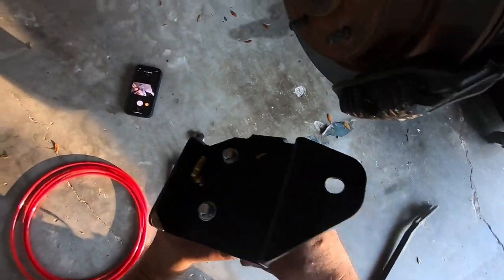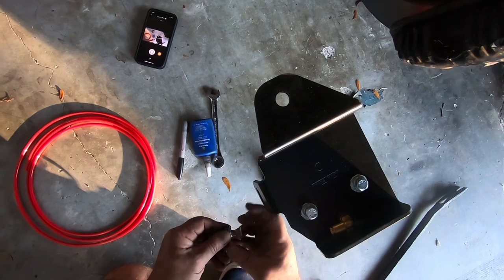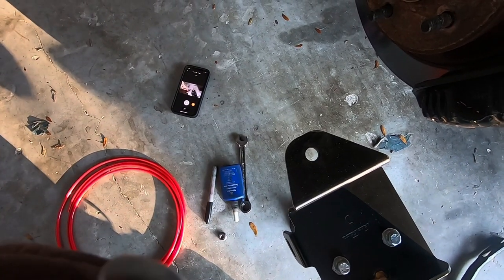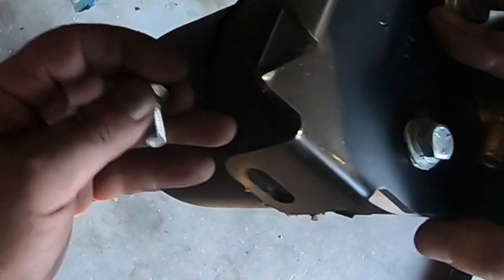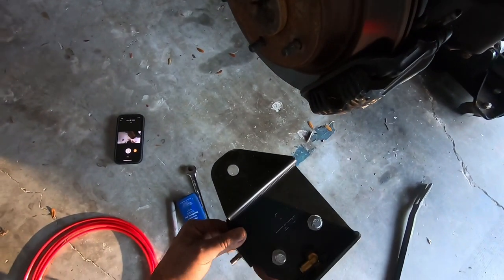All right, guys, got the air spring over here. And again, already prepped it. It's all ready to go. And it's going to go kind of in this orientation here. You're going to have this lag bolt, you can see, the carriage bolt, I think is what they call it. That little square piece there, that's going to fit right in there. And that's so it gives it clearance in the bag, nothing's going to hit it. And you can tighten the nut right here. We're going to have a nut on the other side of this. And that's really it. Shock comes up through this hole, and you mount this bolt, and these things are bolted in. There's nothing to bolt in on the bottom.